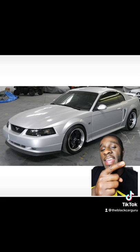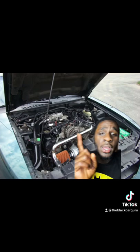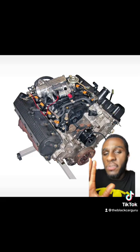It's important to note that the Crown Victorias from 2001 all the way to 2011 also got the PI treatment. So to put it simply, if you have a 96 to 98 Mustang, take the heads off of a 99 to 04 Mustang GT, give it cam springs and retainers, then throw a single turbo kit on it and give it eight to ten pounds of boost.